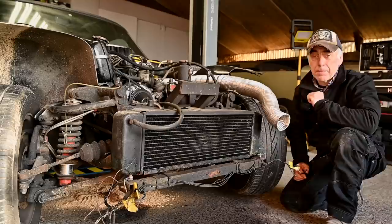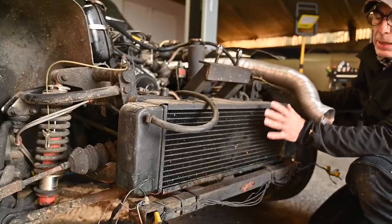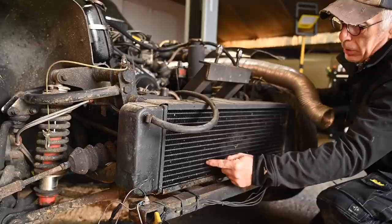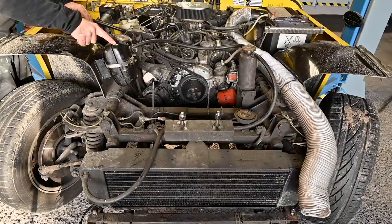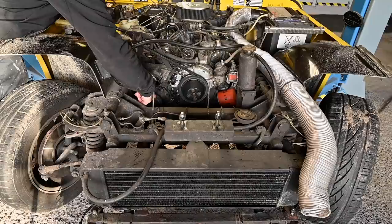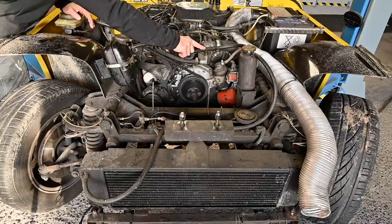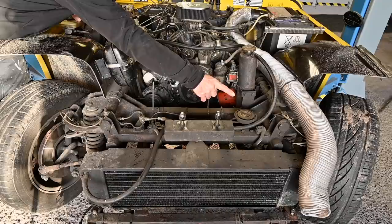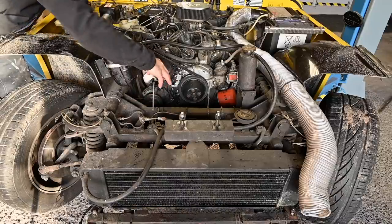To begin with we've got our standard radiator fitted underneath the spare wheel. This is a single flow radiator — water comes in on one side, cycles through from the top down to the bottom through the channels, and then back out. The cooling system on the TVR is pretty simple: we have an overflow tank on the left, an expansion tank on the right, the radiator, and the water pump driven by the crankshaft belt. Then we have the thermostat housing, with hoses going back into the expansion tank and from the bottom of the expansion tank back to the radiator.